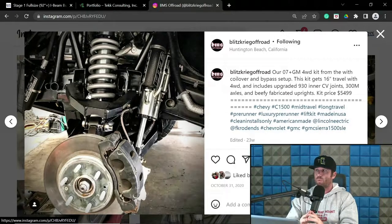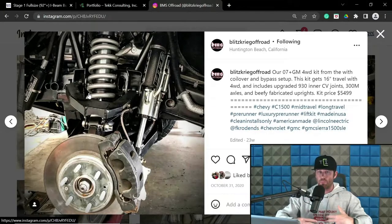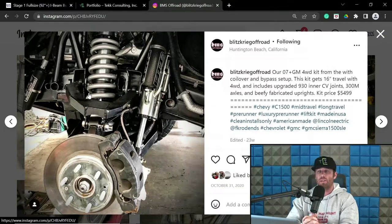So with what Nate is doing, it does create a situation of a little bit less investment overall, because you can get away typically with some fiberglass fenders as opposed to a one-piece front clip. You can keep a lot of the stock stuff, front fascia, stock headlights, stock radiator. And believe it or not, that stuff adds up. That stuff could easily cost more than the actual long travel kit itself or the shock package. So when it comes to these complete setups or installs, you do have to keep that in mind from the very beginning of your design: what your wheelbase tactic or mitigation will be relative to the tire size you would like to fit in the assembly.